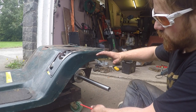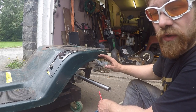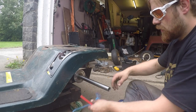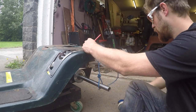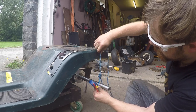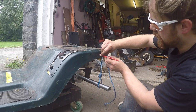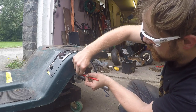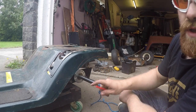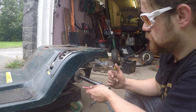One thing we'll encounter is the wheel is going to be running right up close in here, so this piece here needs something cut away to allow for the wheel. The wheel is a 15 inch diameter wheel, so the radius is seven and a half inches. We get this piece of rope, put it around the axle, get from the centre point of the axle — that's seven and a half — mark it with a pen, and then cut away to that line. That should mean the tyre won't foul on the bodywork. Pro tip.